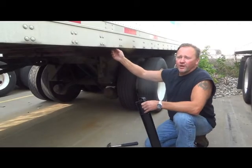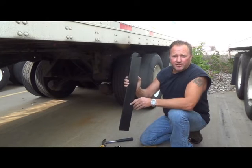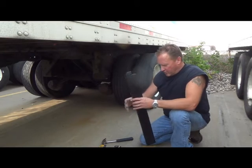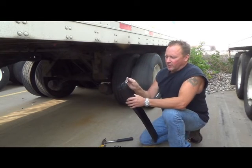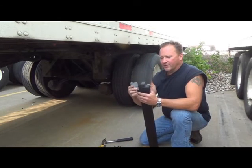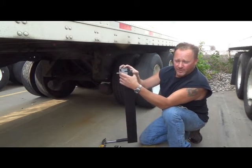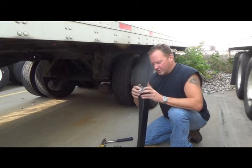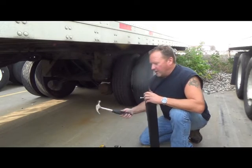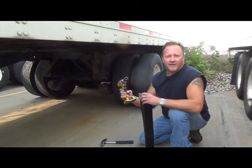All right, now we've established where these stanchions are going to go. Every trailer is going to get 13 of these stanchions per side for a total of 26 per trailer. This stanchion hardware includes a J-bolt, which will go through here and counter-oppose on the I-beam. You'll have a reinforcement bracket, which goes on to reinforce the whole assembly where it cinches onto the bottom of the beam. You'll also have a washer and a nylon lock nut. To assemble this, you're going to need any hammer and a cordless driver with a deep well half-inch socket.